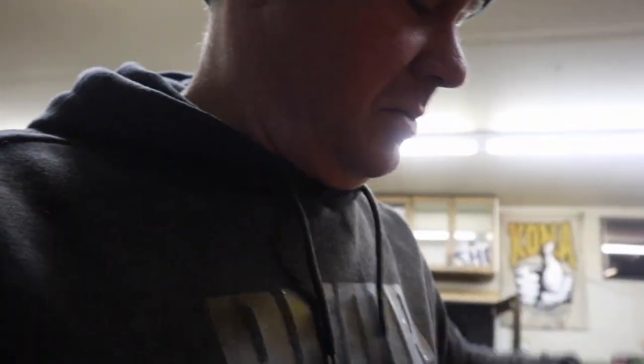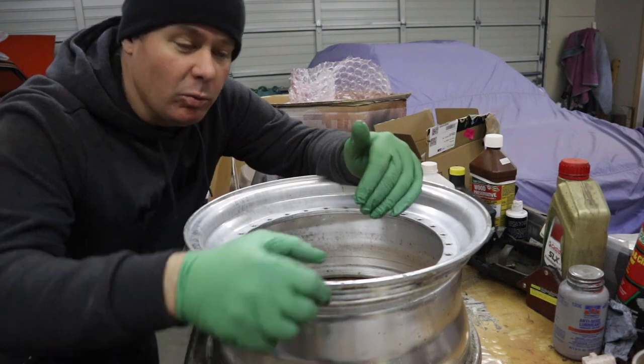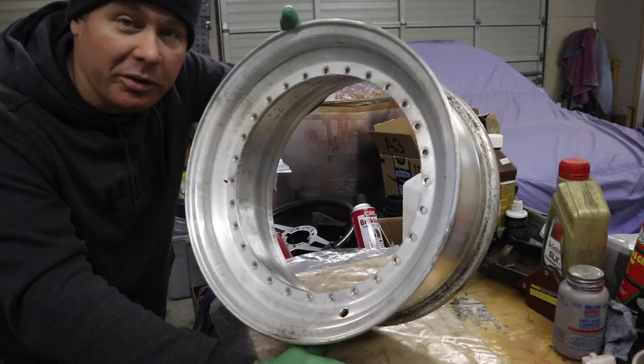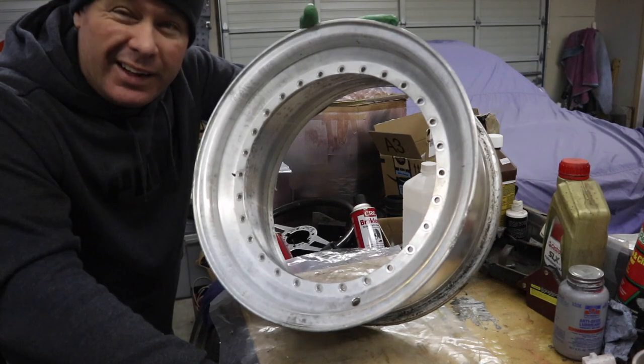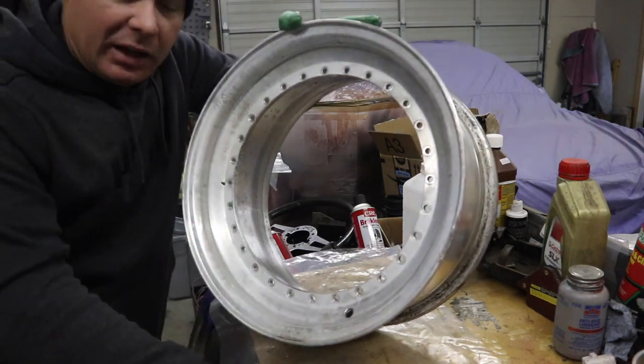But once you work on them for a while it can actually turn out pretty good. You can see here I've just been working on sanding these and they're actually turning out really good. So I think these wheels are going to look awesome. I've also found my center caps so I've got to work on those. I've got two more center caps coming in the mail so hopefully I'll have a nice set of four. Now, after wiping these down with some water to neutralize the oven cleaner, we have a nice clean finish to start with — shouldn't have to sand through all of the anodized coating. So the next step is just to start working my way up through the grits, starting with about 800 since this is a pretty smooth finish already.